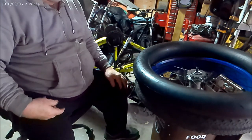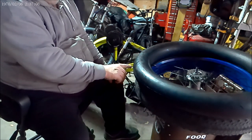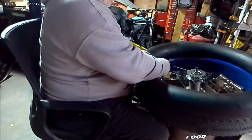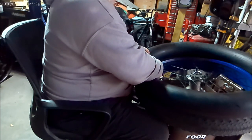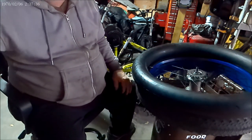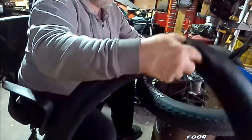Time to patch it. The benefit of the slime is when you're out and about it'll kind of patch the hole temporarily. There's still air coming out of it even though the slime is there, but the benefit is your tire won't go completely flat — it gives you enough of a warning to get home. I went and bought some more slime at Home Depot. Slime does not sponsor this video — I've just tried different types and it seemed to work the best when it came to these sealants.